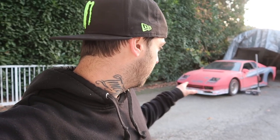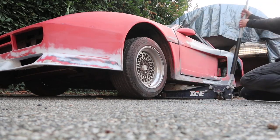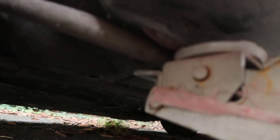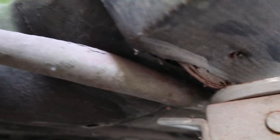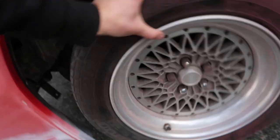My car is so low it's hard to get underneath the front end to jack it up, so I have to go from the side. I found my jacking point on the side of the car. There's a radiator hose that runs the full way right beside that jacking point, so you definitely don't want to pinch that line. If you look underneath here, you can see the jacking point right there, and that line is one of your radiator coolant lines — do not put your jack stand on top of that. I learned the hard way when I was 19 building my first kit car and I ended up crushing both sides of those coolant lines. Just be careful when you're jacking up from the side on Fieros. So let's go ahead and pull these wheels off and mount up the old skinny stock ones.